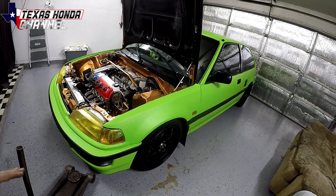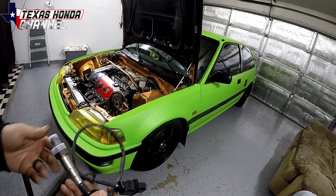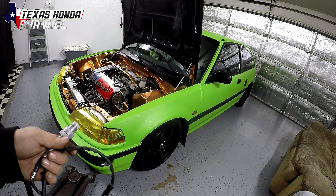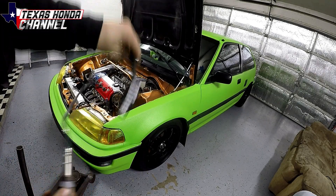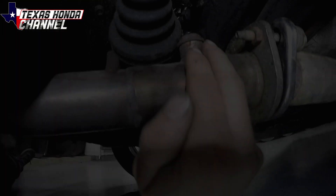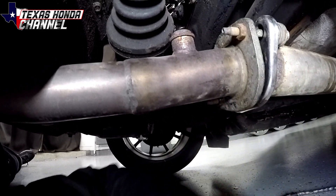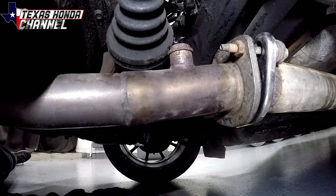One of the first steps is to jack the car up and secure a jack stand underneath because we will be crawling under the car to install the wideband O2 sensor. This kit does come with a weld-in bung, so you could get an exhaust shop to weld it in. But I already have a bung welded, and on the turbo downpipe I have one as well. I'm going to use a 19 millimeter wrench to take that off, and I'll show you that a 22 millimeter actually works really well for the O2 sensor tool.